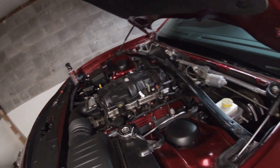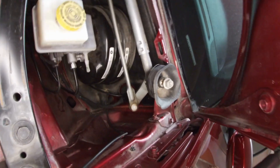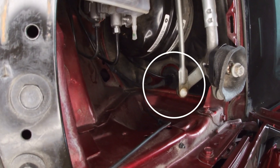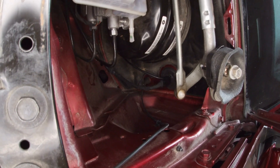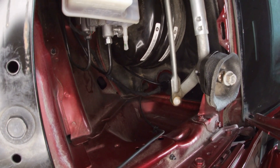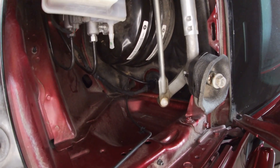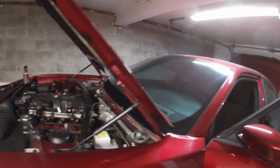A little bit of progress: we had to remove the shroud and the wiper blades so you can get down to the firewall area. You can see the wire coming off there going to the wideband sensor. I just cut a slit in the boot, pulled it out, put the wire in, taped the wire to the other wire so it won't go anywhere, and pushed it back in. If this is all you're doing, that's about all you have to do for that.